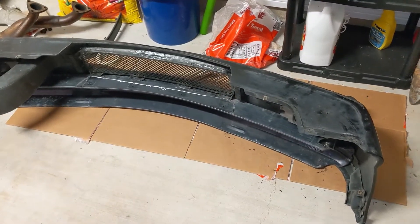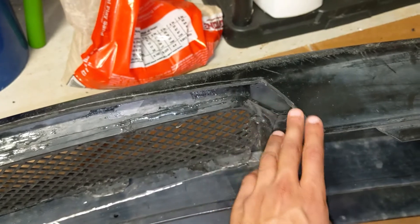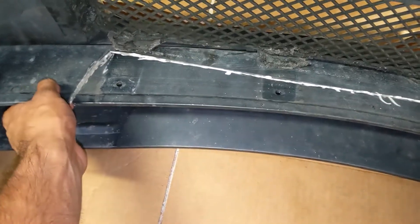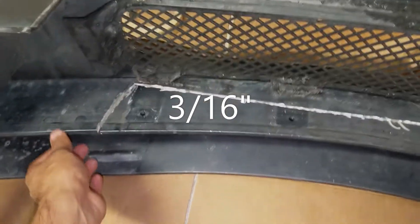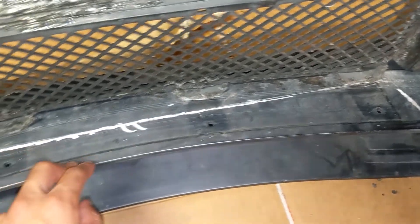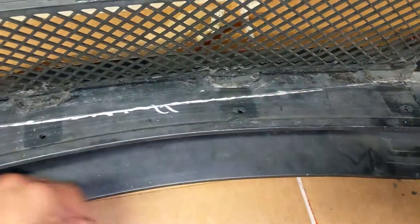I really screwed up on this one. I thought the instructions were saying to cut the bottom, so I did — I made a nice cut with the Dremel, it was easy and didn't take too long. Then we tried to mount the bumper for a test fit and it didn't fit. We realized they were talking about the aluminum part, which is like quarter inch down to three-eighths inch — really thick. The Dremel was having a really hard time cutting it, so I probably have to go get an angle grinder to make this cut, because the reinforced bit was barely cutting it. We might even have to go a little farther back to make it fit, but that's where we left it for today.